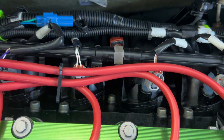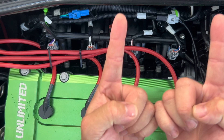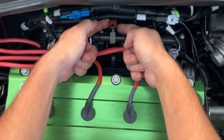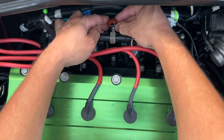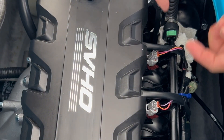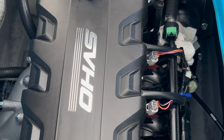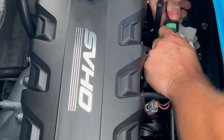Before we get to that, we're first going to remove the gas cap to vent any excess pressure that may be in the system. Then you're going to take two fingers, one on either side, and put them on either side of this connector. You're just going to pop up those tabs right like that. Do not push it by the clip — push it by the body. And we're going to pull that fuel rail off. Pop that clip up just like that, and use two fingers to push against the clip while another two fingers work that damper off of the rail.